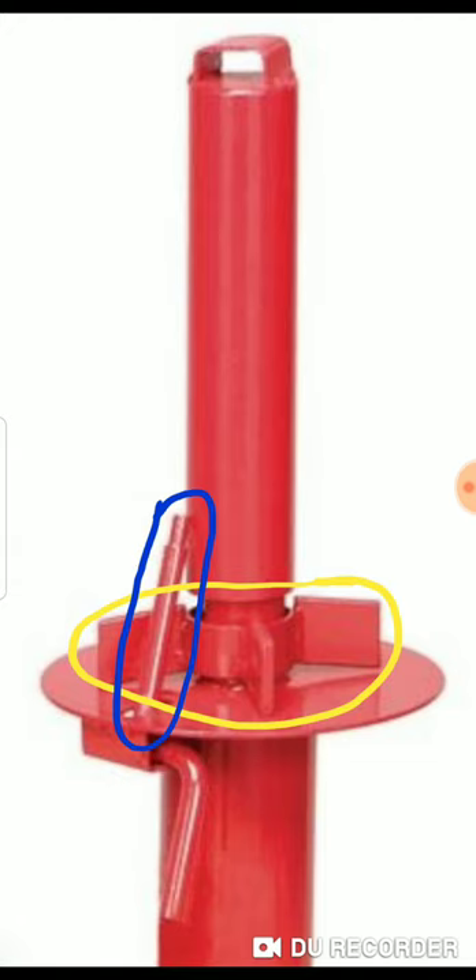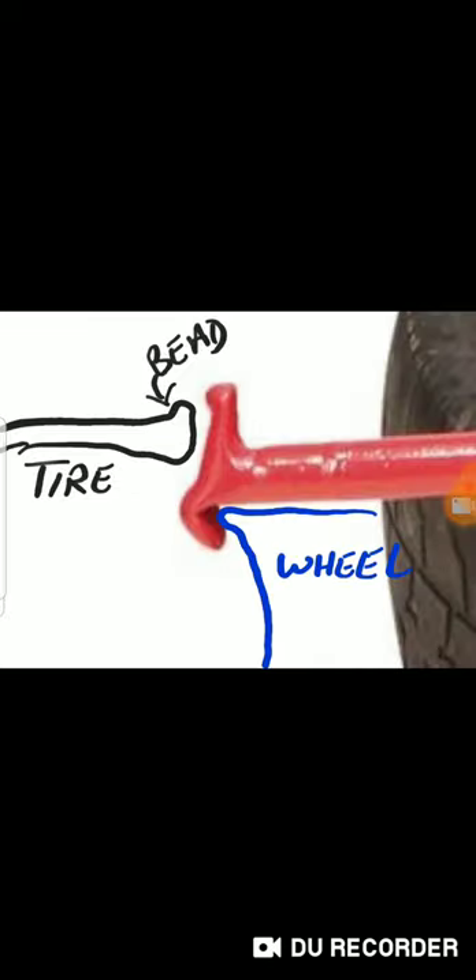If it's loose, you'll cause a bulge or flat spot on your wheel. With an aluminum wheel, you'll end up with a bulge where the pin is pushing against the side of the lug, and the wheel won't sit flush on that flat platform. When you put it back on your car against the hub, it won't sit flush — you'd have to grind it off or hammer it back. Make sure your wheel is secure and not wobbly. For dismounting, I use the top side of the bar against the wheel and the bottom side against the tire — I've tried it both ways and this works better.